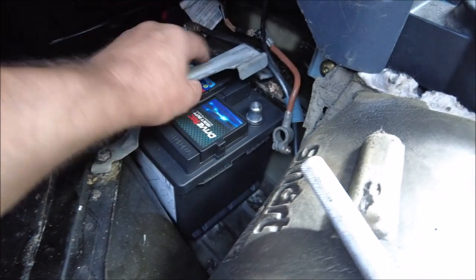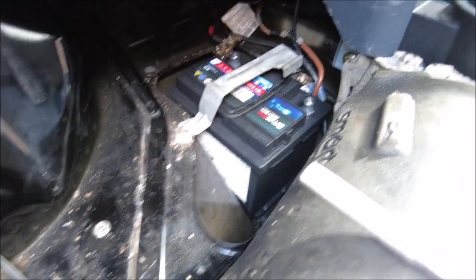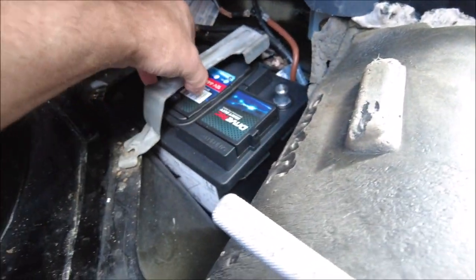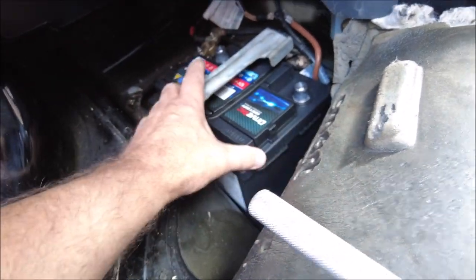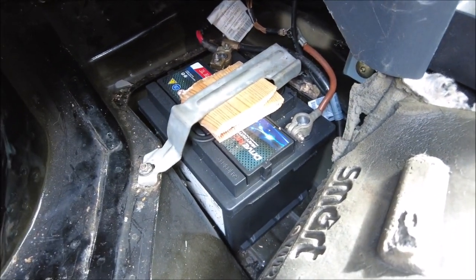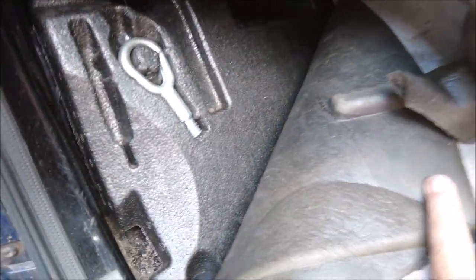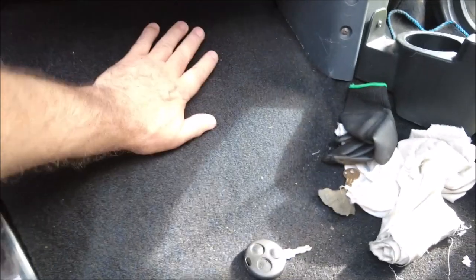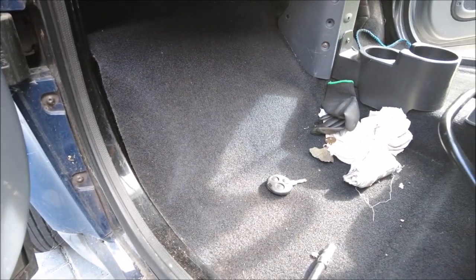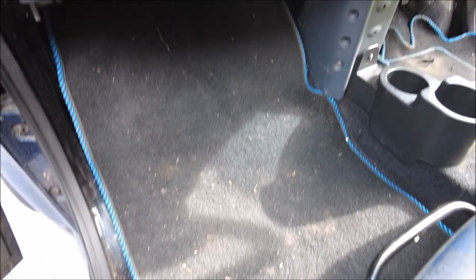It's the right battery for the car but I must be doing something wrong — that doesn't look right. I've definitely got it in the right slot. I think prudence would say that needs a bit of wood or something under it to keep it firm. Well, I wouldn't say it's the prettiest job ever but I've got the wood in place, the battery is solid — that'll do for me. That backing board is back in place and all this carpet goes back in like that. We have replaced the battery, simple as. With the mat back in place you'd never know we've been there.